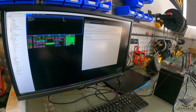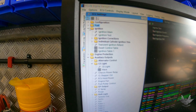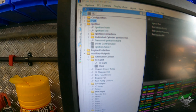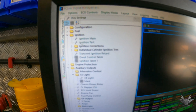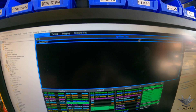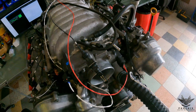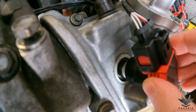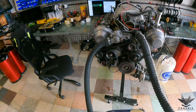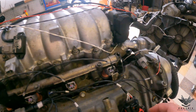Now we're going to do pretty much exactly the same process for ignition. We've finished with fuel, so we'll close that down, and then we've got ignition just underneath — click that little arrow to open the sub-tree, then go to ignition test which is the second one down from ignition main. This is a really nice simple window — you just have ignition test, and if you double click it you've got ignition one to eight, exactly the same as the injectors. As soon as I click on there you can probably actually hear it clicking away, and if I gently try and lift this up, there you go — you can hear that clicking like mad.